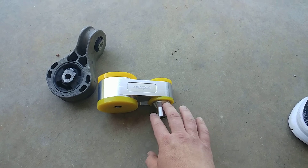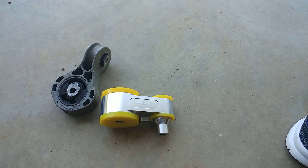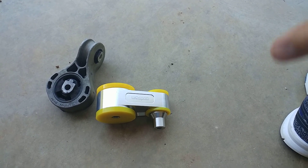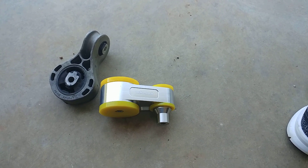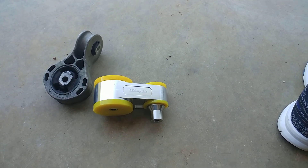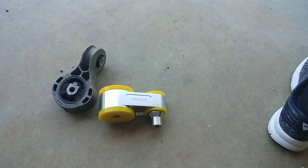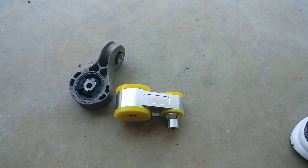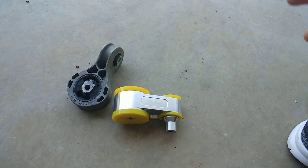I've been researching motor mounts for like two years on these cars and I came up with basically two mounts I was going to buy. I was going to buy the AWR-70 — that's the softest one they have. I thought it was a really cool mount. I liked that it had its own bracket on it so you didn't have to use the old bracket off the car. But then I saw this Whoosh mount pop up. Ron spent the time to develop this part and said it's supposed to be a really good happy in-between — it's going to be stiffer but it's not going to add a whole lot of vibrations. It's that perfect blend. Also, the AWR mount is made out of steel; this is billet aluminum. That's why I chose this mount.